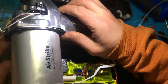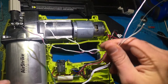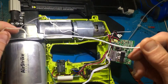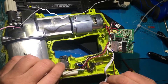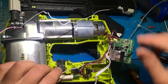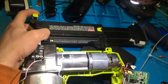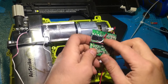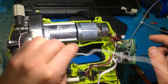You're going to have to lift this part out — these two wires are usually wrapped around the back side of it. Take these two wires and disconnect them. This one with the red stripe, we're going to wire that directly to the ground on the battery terminal. Then this other one is like a switch — it's activating a push-down mechanism for a safety feature. Then we're going to take the negative off of this circuit board and run the negative from this switch to the negative of the motor.